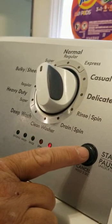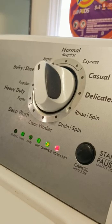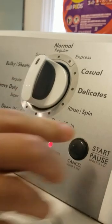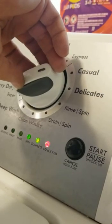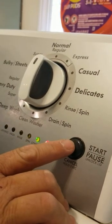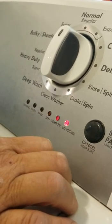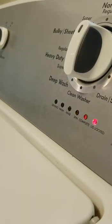The reason I like to leave these off — and for other reasons — is you have to wait for the basket to completely stop before you can select something else. Since I've got this thing loose, I can reach down in here with gloves on and rest my hand against the tub to slow it down quicker. Next is your agitate. The actuator will be shifting right now down below to put the clutch into the right position. This is letting the bearings, the gear case, everything move around and seat better — including the seal. That's your short agitate.